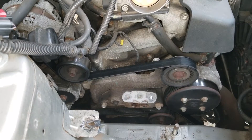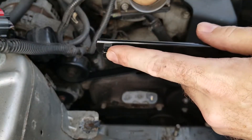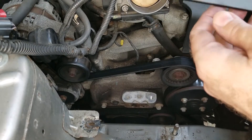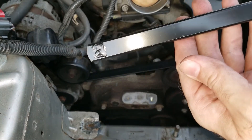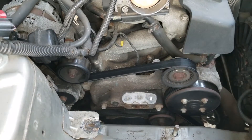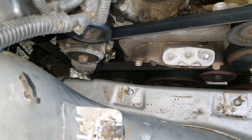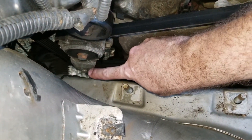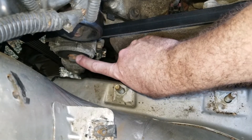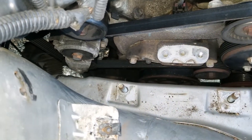Here's what I was talking about — this is the tool with the really thin, small end here. I'll show you where that hole is on the tensioner. Having a tool like this is absolutely going to help you and make this job easier. You don't have to lift the engine up really far, just enough to get the tensioner out. If you look down here, that's where the tensioner is — this right here is the tensioner down in here. That's where you're going to stick that tool, the belt comes off, and then we'll remove the 16 millimeter through bolt that goes into the block — and the whole tensioner will come straight out.